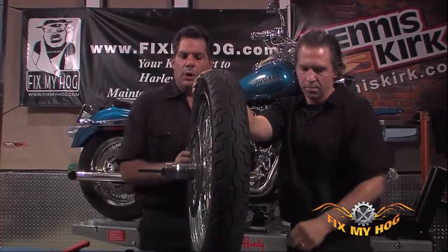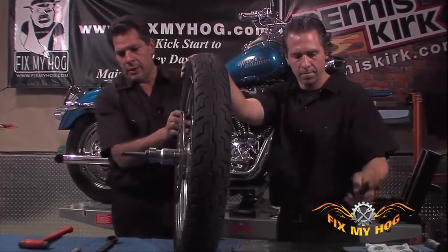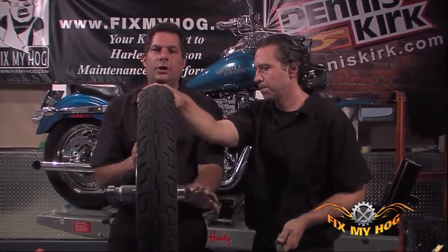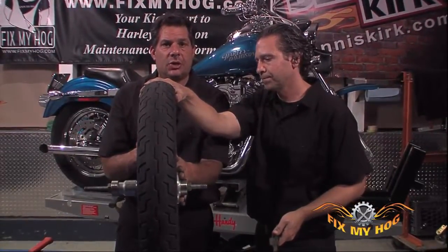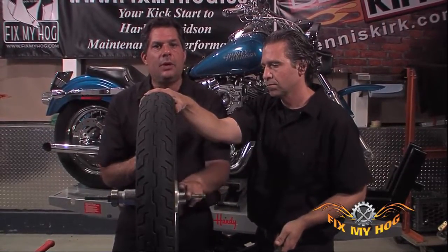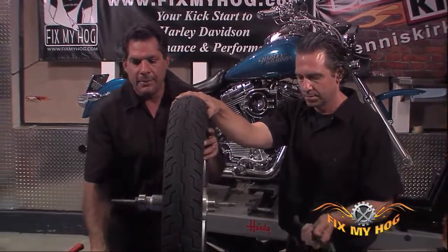It's a very important time to get a good view at what you're doing. Make sure the collet or the socket or the piece of pipe, whatever you're using on the non-rotor side, the bearing we already installed, is only pressing on the outer race of the bearing. You don't want to damage the bearing you already installed in order to install the bearing on the rotor side.